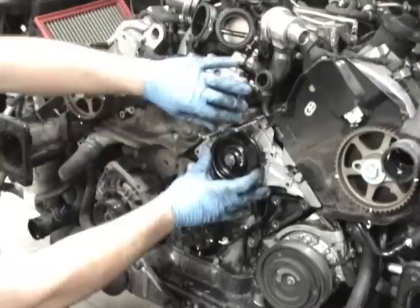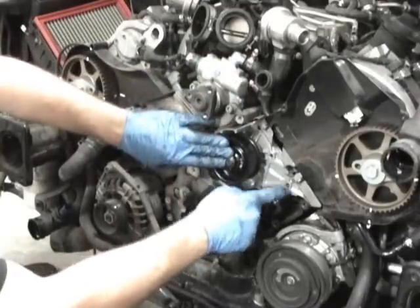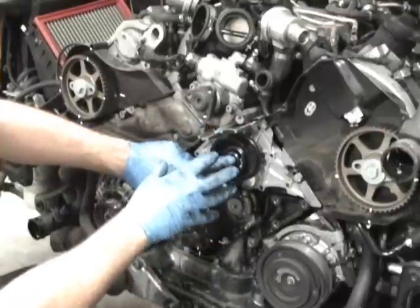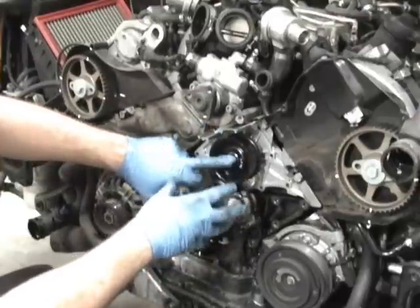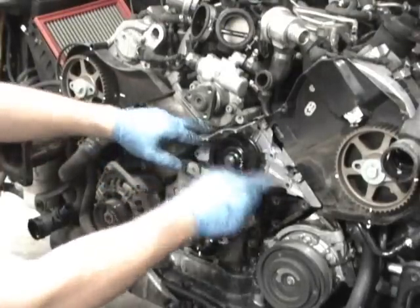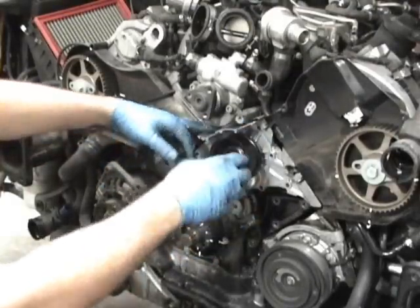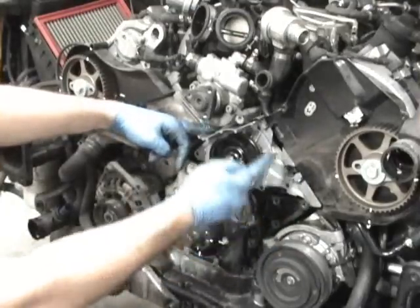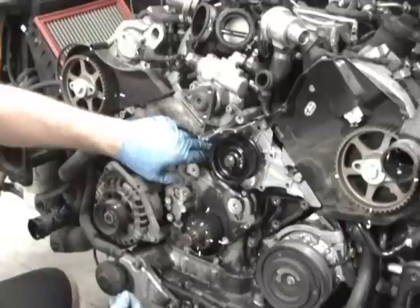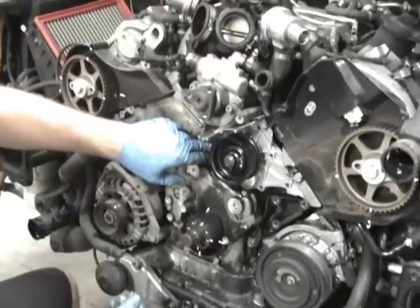And before you start sticking the bolts in, you want to look in there and really make sure the gasket's lined up. Start dropping the bolts in, and I'm going to come back when the bolts are all in. But at this point, you just make sure the gasket's lined up, nothing's sticking out, the gasket's not folded. Really look around the perimeter and get all the bolts in, and then you'll end up torquing those to 10 newton meters, which is about 8 foot-pounds, and then I will come back.